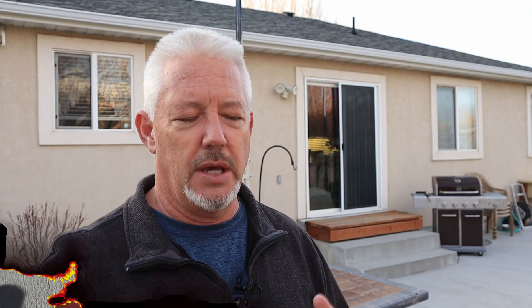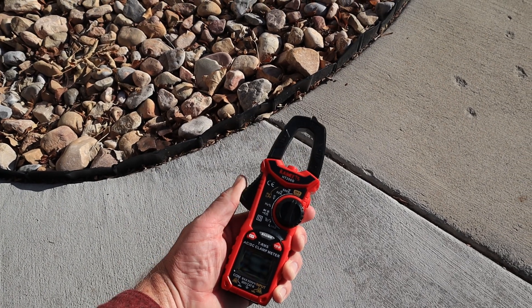The next thing we're going to do for this test is get ourselves a DC clamp meter — I'll put a link in the description below for the one I'm using. We also need to know how many amp hours our battery has; that rating tells you how much power is in your battery. You want to stop at 50% and then recharge your batteries. If your amp hour rating is 100, that means you have 100 hours to use, except you can only use half of that. So a 100 amp hour battery gives you 50 usable amp hours. That's the most technical information I'm going to cover — let's get out to the camper.